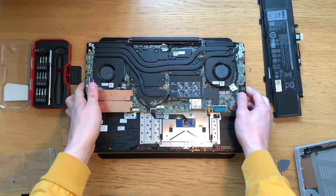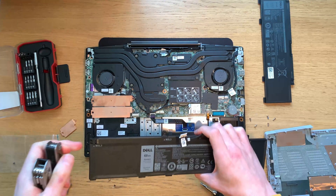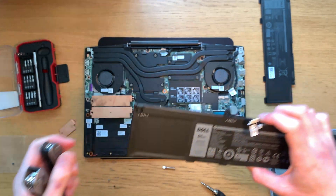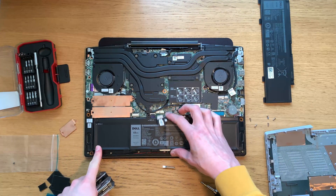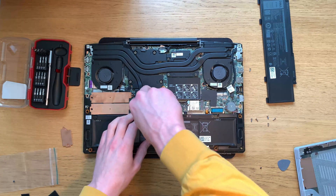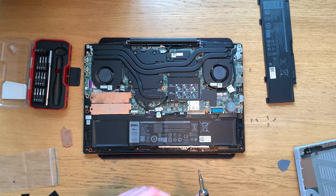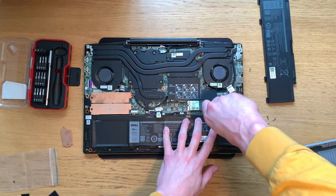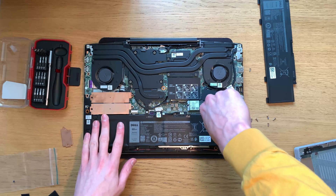That's a good thing I gave that a shake. I'm fairly confident that all the bits of metal have come out of there. I've screwed the standoff into the bottom here — I thought that screwing it in there will give it slightly more support. Dell sent a longer screw with the battery to go into the middle hole where it connects through the heatsink, because the factory fitted screw would be too short to go through the battery and the heatsink, so I used the longer silver screw in the middle here.